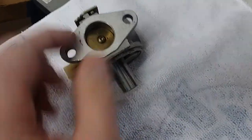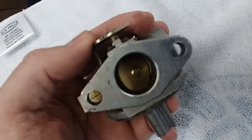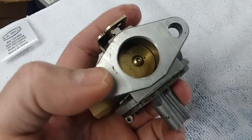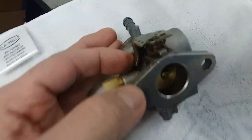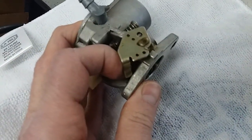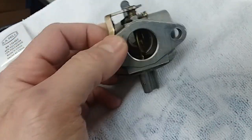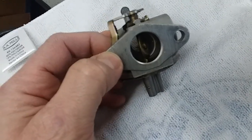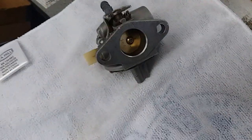It's usually a fuel problem — it's not getting fuel up into the carb to run the engine. I've had situations where I did have idle problems, and I'll link those into the video. One was actually the spring that goes on to the governor that was missing, and another one was just a dirty carb, but it never really required a governor adjustment.